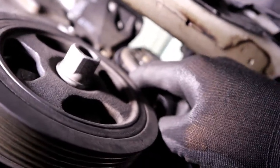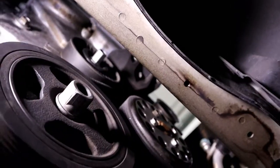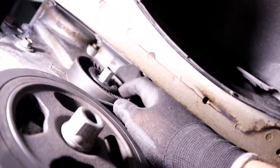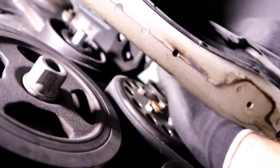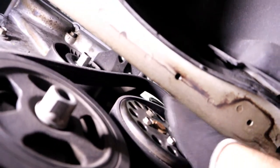I'm gonna pass you off to my buddy who's actually working on the car — just follow his steps and you'll be able to see how to put the belt in properly. First, put the belt around the crankshaft, then around the water pump and the other pulleys. Make sure to follow the diagram — put the alternator belt back on last. Once everything is routed correctly, you're done.